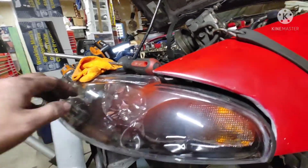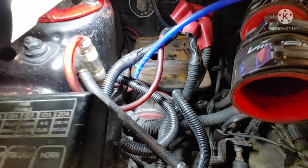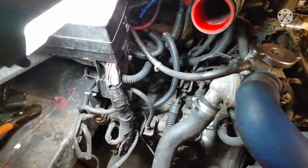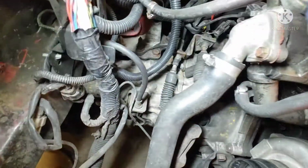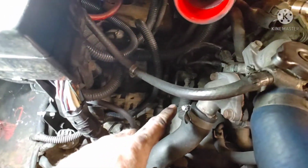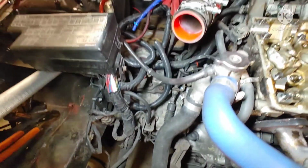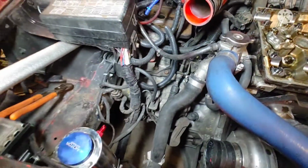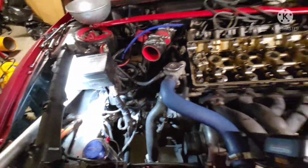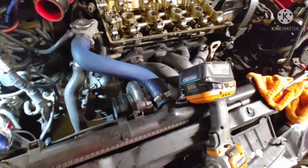Then, you know, just finishing unhooking everything else. We already got this motor mount. So then there's, let me see, a transmission mount there, that little red sucker down there. And then unhooking these linkages and stuff here. Right there, that linkage, the hydraulic clutch line, probably. I'm thinking that's what that is. And then any wiring, all this wiring, will just pull off and come off to the side. So I'm working on just trying to get the front side of the exhaust off.